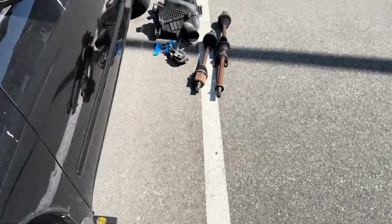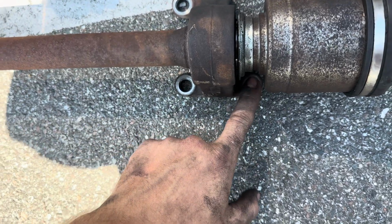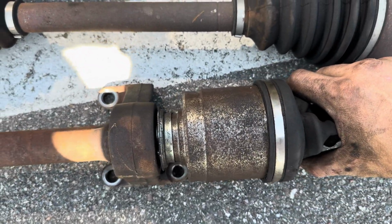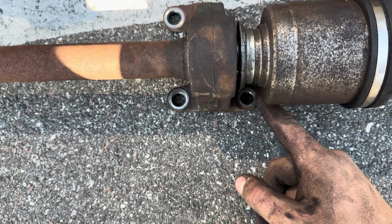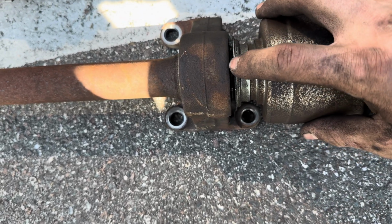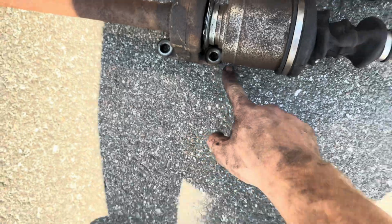Now, I told you you could leave it in, and you can, but I just went ahead and took it out. Here's the bracket I was talking about on the side of the engine block. Now, this nut was hard to get out. I actually had to use my left hand to pull this back while I fit a wrench, because the space was too tight on this side to fit it in. So either you have to have a thin-walled wrench or pull this back. As you can see, it's a little separated, to fit your wrench in there and break it free, and then you've got to do the rest by hand. It's really tight. That one is really tight.